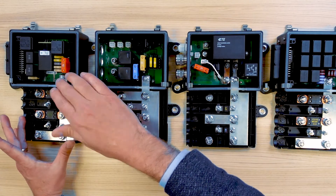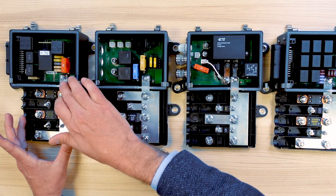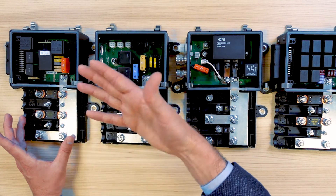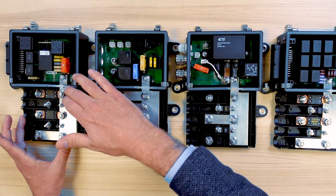Finally, in that last example, we have implemented a relay-shape CAN controller into the box in order to receive commands from the CAN network and activate and deactivate the other relays inside the box based on the information received from the CAN network.